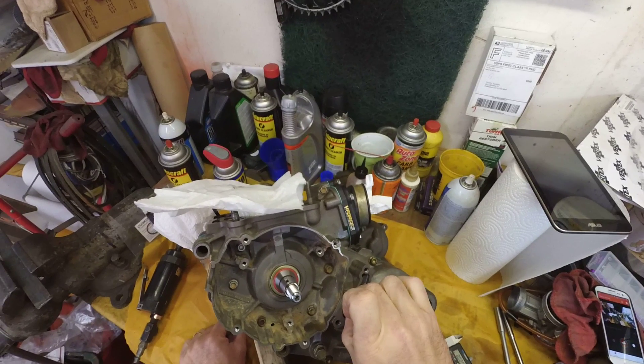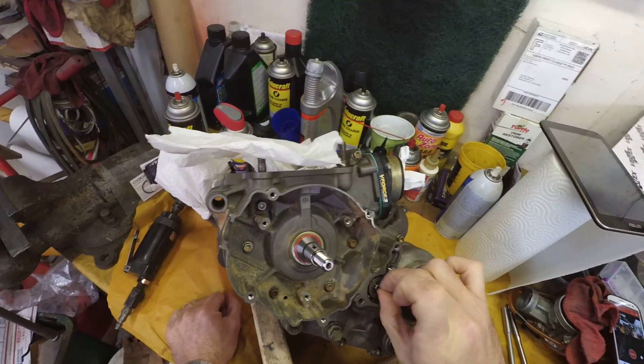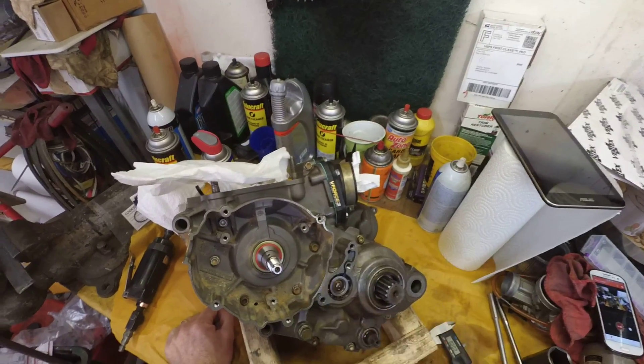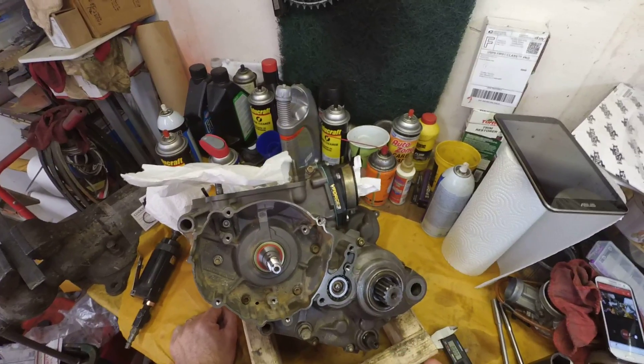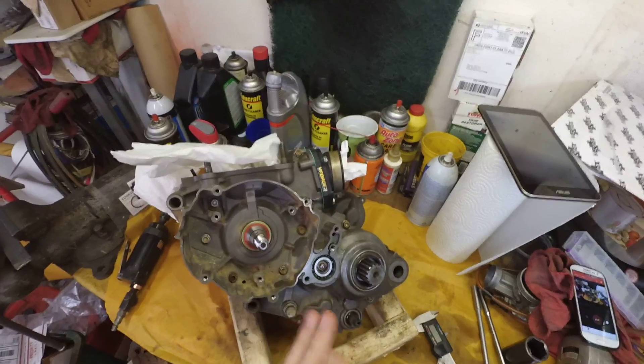It is slippery with oil but I can kind of grab it and pull it out — this is the one that is coming in underneath your clutch. This goes all the way in and depending on how worn your clutch is, this thing is going to be sticking in and out. Think of a cable clutch and how you adjust that little bit of free play in the cable — it is kind of the same thing we are doing here.